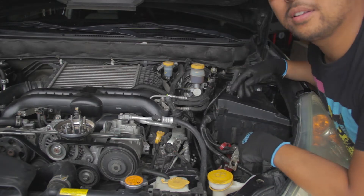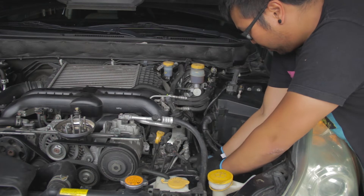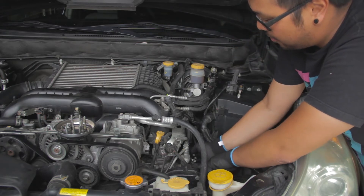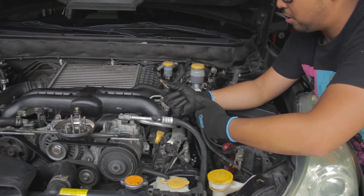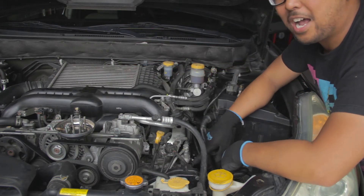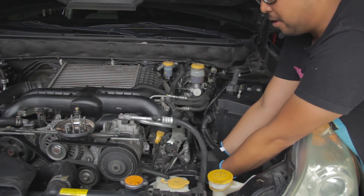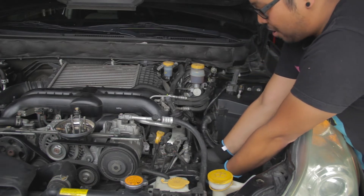Now the moment of truth to see if I can pull this thing out. You have to apply a little force because of the gasketing — there we go, popped right off. So now take the last bolt. That last bolt prevented me from pulling it all the way out and slamming it into the wall. You may be tempted to pry it out with a screwdriver — avoid that at all costs because you'll damage the mating surface. Just use some force and stick your thumb in the hole.